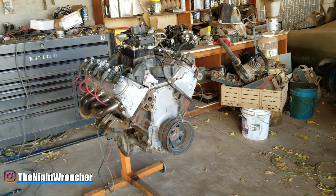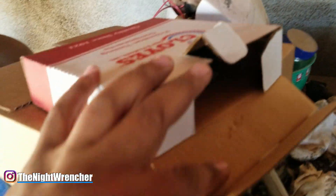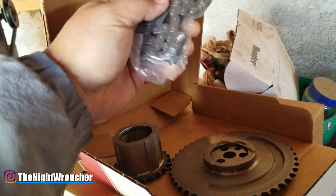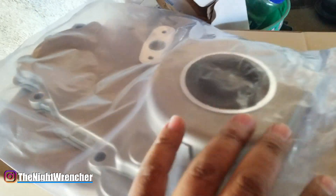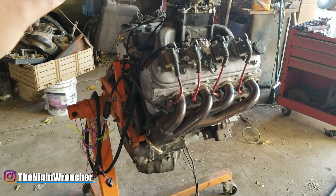This is a Gen 3, so it does not have the front cam sensor — it's all in the back. The technicians at Daytona Sensors said it might not work with a typical Gen 3, so you may have to switch over to the later front-mounted cam sensors. That's basically just a timing chain kit you can pick up from your local parts store. It includes a 1x cam gear, a regular crank gear, and a brand new timing chain. I also picked up a front cover made by Dorman — a universal front cover with two holes instead of one, and it comes with a plate to block off the extra hole on a Gen 3, or use it for the cam sensor on a newer application.